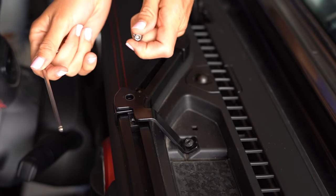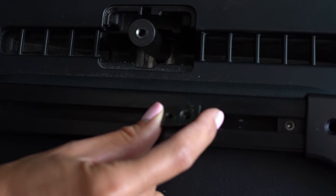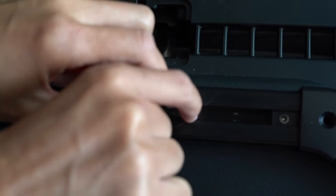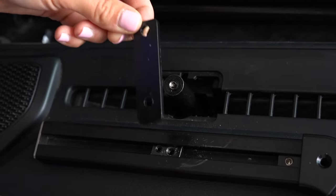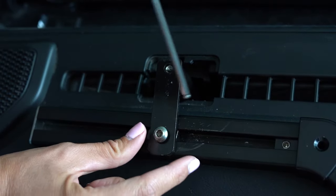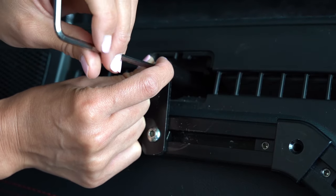Keep all the hardware loose until the final step of installation. Now we're going to place the bolts using a 5/32nd allen key. For the driver's side mounting bracket, a drop-in insert is required — place it in like so. Use a smaller bracket on the driver's side; one side goes into the drop-in insert and the other side goes in like so. It's important to use the same bolt that came in your standoff on the correct side because the thread is different.